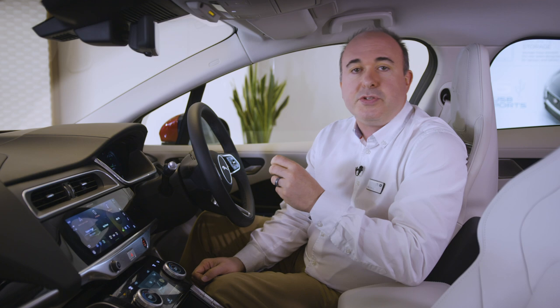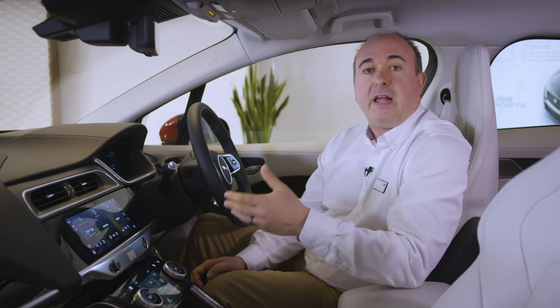Each authorised user of the vehicle can have their own profile linked to their own InControl account. When you've done this, you may receive a message saying there is no internet connection and giving you the option to enable connectivity. Select this and then switch on mobile data and agree to the terms and conditions. Once you've enabled mobile data, return to the sign-in screen by pressing the X at the bottom right of the screen.